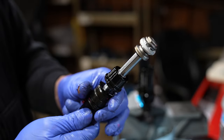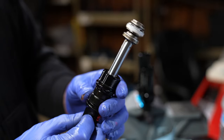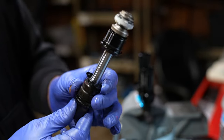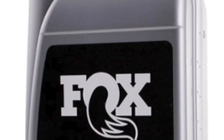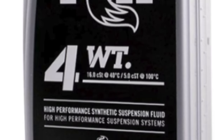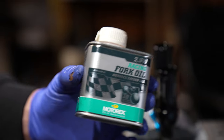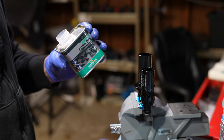This is the main technology within the DHX — it's a massive piston, even in comparison to a Fox Float X2. When I pulled this piston out there was quite a bit of friction, and that may be where this shock lost its small bump sensitivity. The DHX takes lighter oil than even the Fox Float X2, and yet it feels like it has less small bump sensitivity — so it's kind of interesting. I'm going to try to butcher this thing together using Motorex 2.5 weight oil. Super expensive good stuff. We're going to fill her back up and do a botched home bleed job.